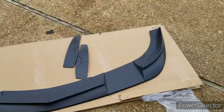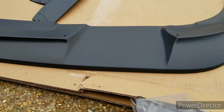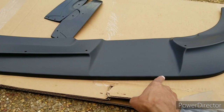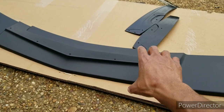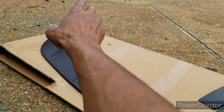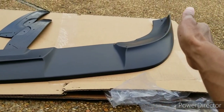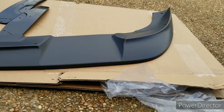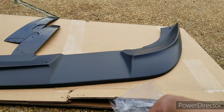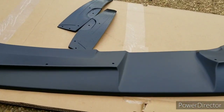What I'm doing with this — I could one-piece it, but I want to get this done without worrying about anything coming back. So we're going to do a couple of inserts. This big middle section right here I'll do first, lay some knifeless tape around and cut the edges. Then I'll do the middle section, this little piece, and the side pieces first — then the middle section will overlay so the seam is hidden from viewing angle. Usually when wrapping seams, you do the back before the front, or the bottom before the top, so when you look down you miss the seam.